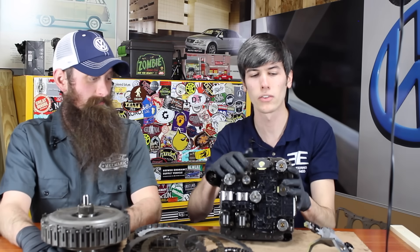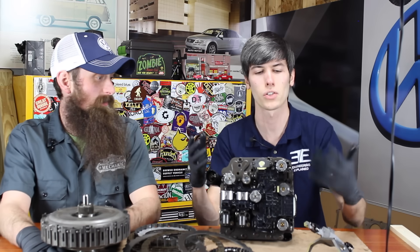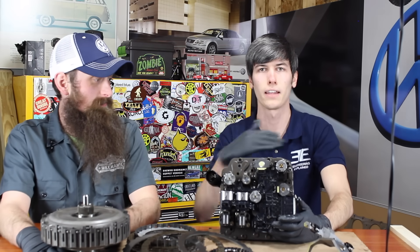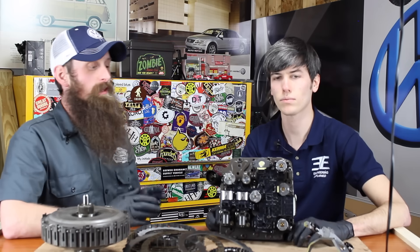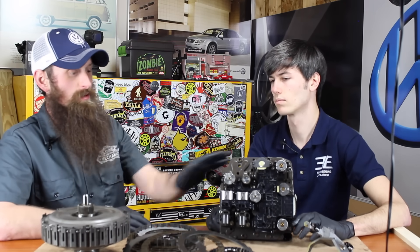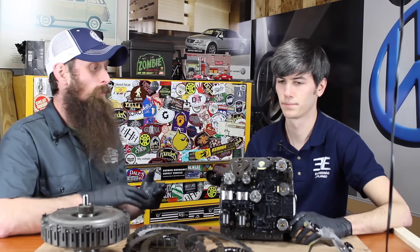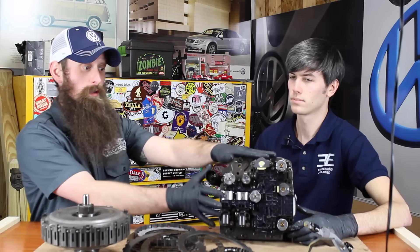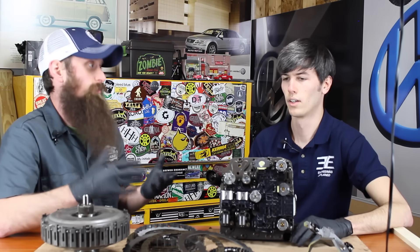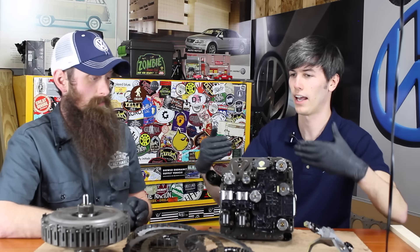What I have here is the mechatronics unit, and basically this is responsible for the logic of the transmission. You may be wondering how it knows which gear to pre-select. Some simple examples: if you're in second gear and you're flooring it with RPMs increasing, it'll go ahead and pre-select third gear so you can get into it very quickly. If you're in fifth gear and you're hard on the brakes, it knows to downshift, so it'll pre-select fourth gear. This really explains some misconceptions about this transmission — it's a manual transmission that just happens to be automatically controlled. That may explain why, under certain driving conditions, a driver may experience a delay or a weird shift, because the computer can only predict a driver's input to a certain point. If it pre-selects the wrong gear and you go the other direction, you may feel a slight delay because it has to compensate for that change.